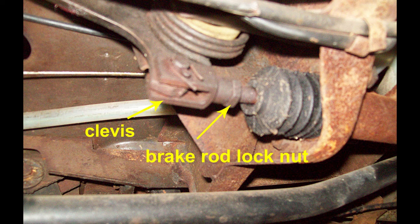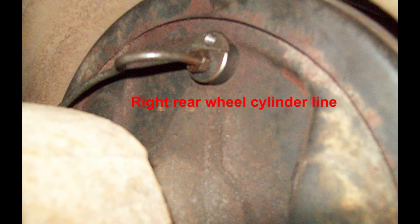Don't forget to check your master cylinder actuator rod to make sure it's adjusted properly — take out all free travel. Loosen the lock nut, push the boot back, and hold the rod with a pair of vice grips. You can adjust that rod to take all free travel out. You don't want to have that master cylinder piston pushed in at all, so adjust it carefully. You have to take the bleeder screw out on this to get to that line nut — it's that close.